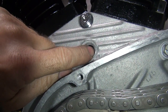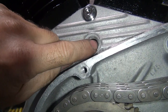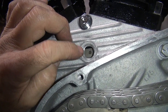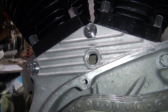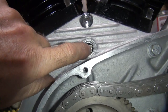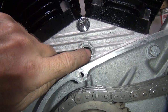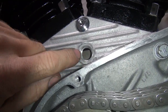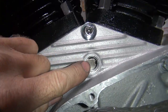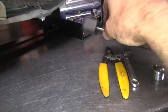Okay, this window is 8 degrees wide on the inside of the thread. It's 10 degrees if you go behind the thread. Okay, we need to gain 12 degrees. So what we're going to do is we're going to go back right to there, which is a full 5 degrees back, because the center of the hole is right even with the thread. Not on the inside, but even with it. See the mark back there? It's halfway through.